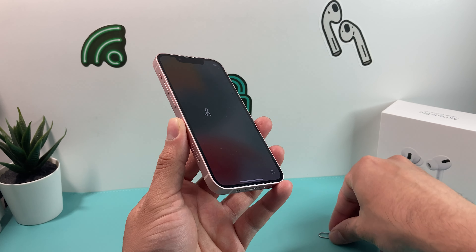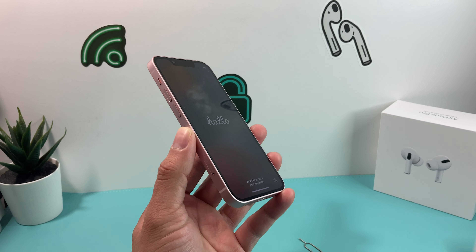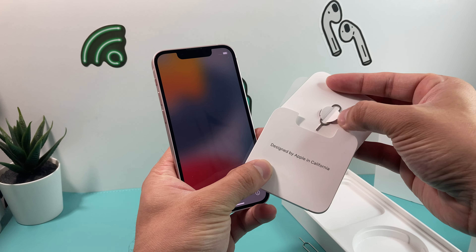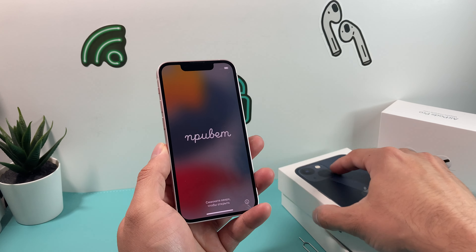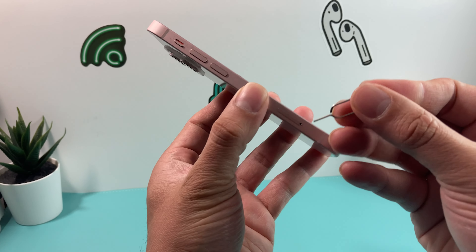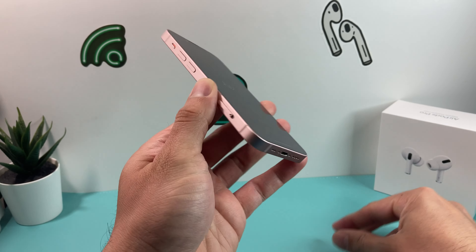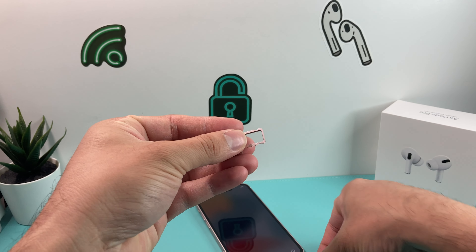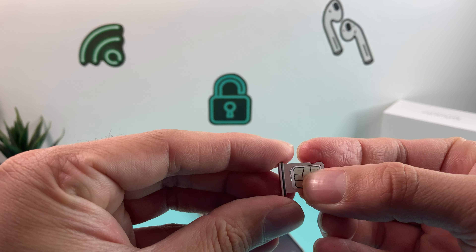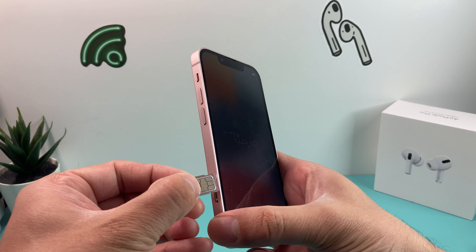If you don't have one included or need to transfer one, it's pretty simple. You're going to have this SIM ejector tool, which comes as part of your package. If you open up your package, you'll notice there's a label and then the SIM ejector tool. If you don't have it or you're buying a pre-owned phone or you lost it, you can also use a paper clip bent so it can go into the hole for the SIM tray. Simply press and hold, pull that out, then line up your SIM card. You'll notice there's a cut corner — you want to make sure it's flipped like this, that cut matches, then line up that hole and put it back into your phone.